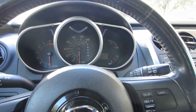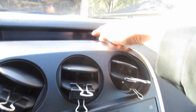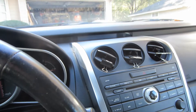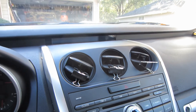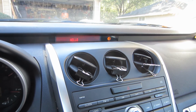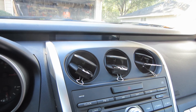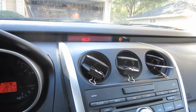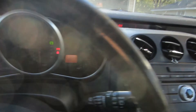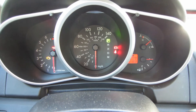Code 18 is for the PAD light, which is the passenger airbag deactivation light, right here. This illuminates to tell you that the passenger airbag has been deactivated. Now if we turn it on — oh, now it's on. It's supposed to come on when you first turn the car on. Since it's intermittent it's decided to start working again with the camera rolling, and because everything's working, our airbag light has gone off as well.